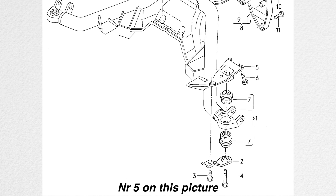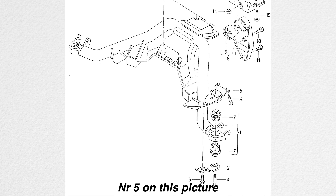You can bolt and mount the subframe to these mounts, then to the chassis. The only thing you'll need to do if your car is not Synchro is make this rear mount — I would make some kind of metal bar and mount it to the back of the differential, kind of like I already did on my Mark I. This guy who built this did a simpler way — it's just metal on metal on the rear mounts. For the subframe mounts you can make your own, or buy weld-on parts. There are a lot of companies selling these. I made mine myself, but it's almost identical to what you can buy — I just did it because it's cheaper.